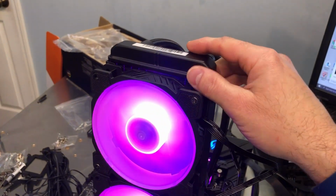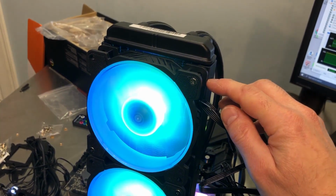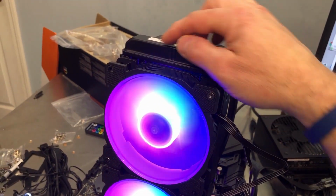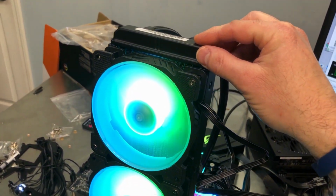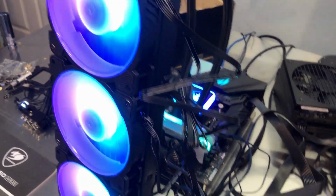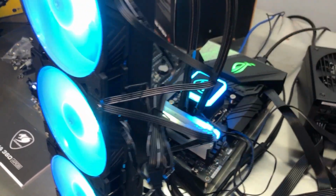And the air is in there. That's normal. You have to have a place for the coolant to take up a little bit of space when it expands. So if you didn't have any air in your system, then the expanding coolant could push out through like a seal in the pump, and you don't want that.